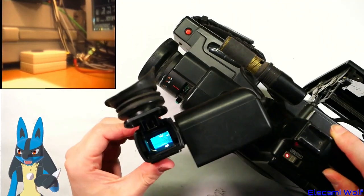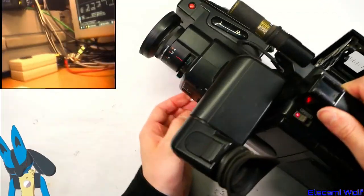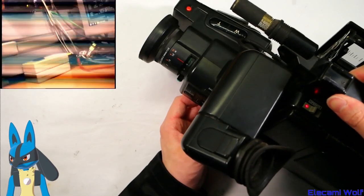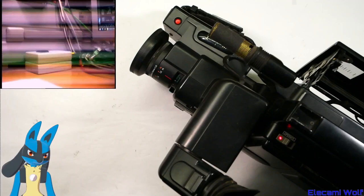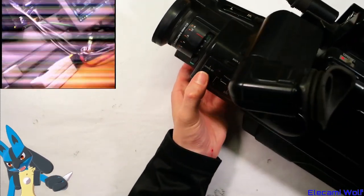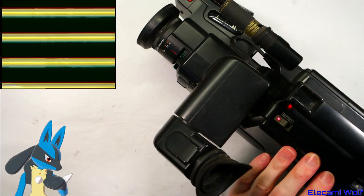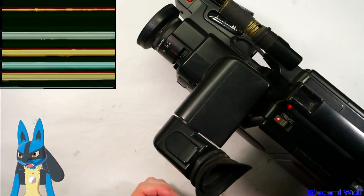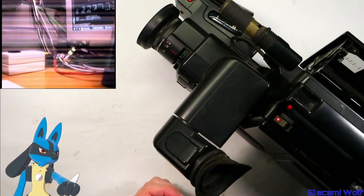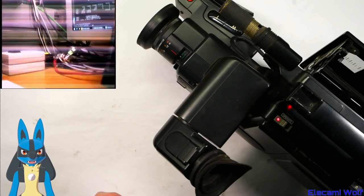The viewfinder's lit up. The power zoom's not functioning. The white balance is a bit off — set it to auto. It's going a bit crusty. I wonder if this power supply is on its last legs, since it was dodgy for both of them. It doesn't go into standby — I wonder if it needs the tape operating for that. Perhaps I'll grab another power supply and try it, just in case the power supply is dodgy and not giving a clean voltage to the camera.